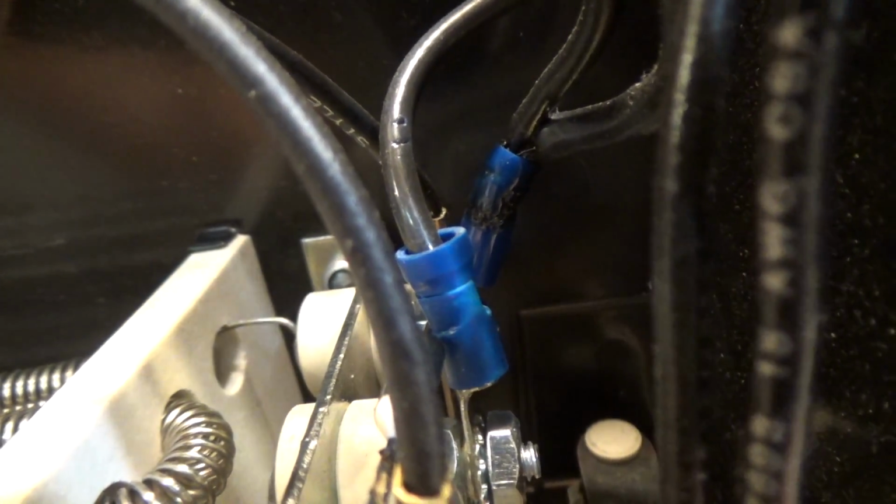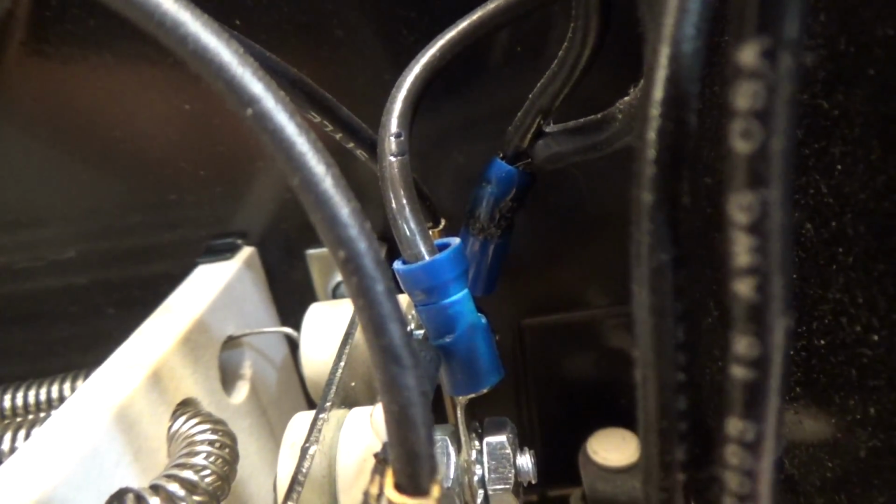What I don't understand is that this wasn't running for very long when it quit. There's times that this thing runs 5, 6, 7 hours at a time. Today, it was on for just a matter of moments before it quit. So, I find it odd. It's not impossible that perhaps this connection, for whatever reason, was heating up over time, and today was its breaking point where the insulation or the connection became distanced and there was an arc or something like that. I'm not entirely sure, but we're going to have to remove some of the wiring in order to figure it out.